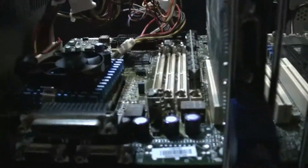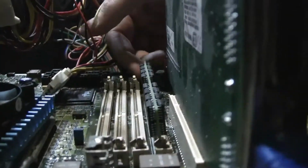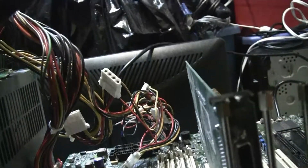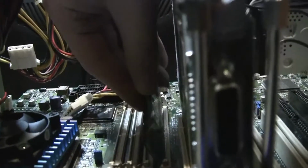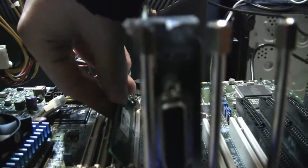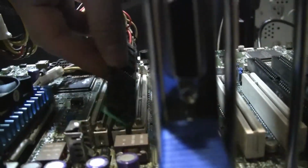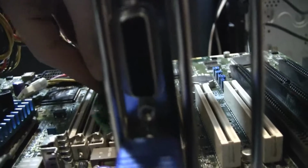Okay. According to the manual, that is a bad memory error, so let's go ahead and see if we can eject this, but in a different one. What is this, Samsung? I'll try the Samsung. I really don't like how these go in. That gives me some concern regarding the board. Let's see, is that even in right? It's not easy to do. Let me try this one. Not sure which one I'm supposed to be using either.